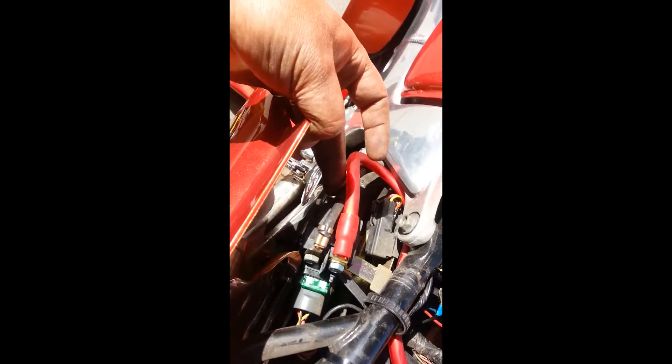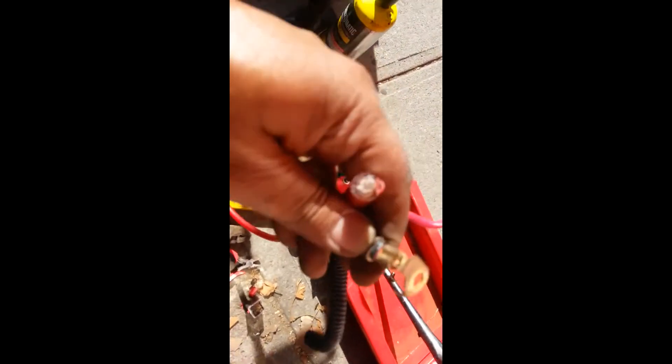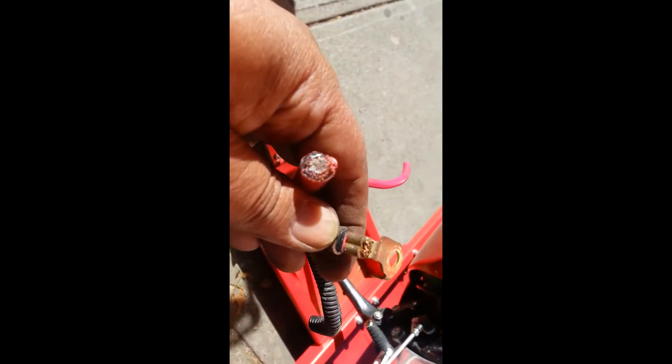You can see the second wire I'm working on. I'm not using anything fancy. I just want to compare the wire sizes. The upgraded line is four gauge, and the factory line is whatever — somebody said online it's like seven or eight gauge. So hopefully this is going to resolve my issue.